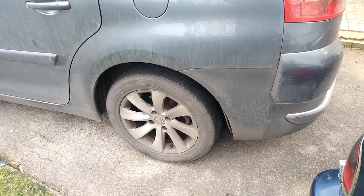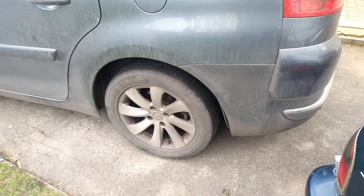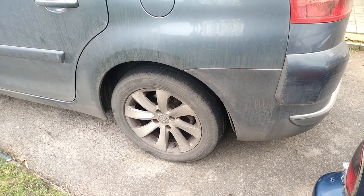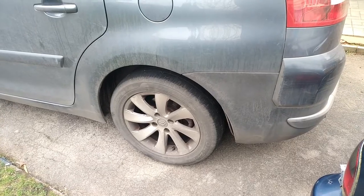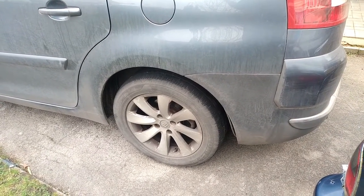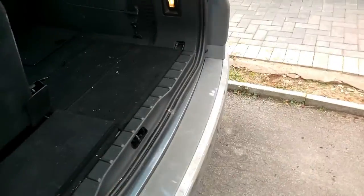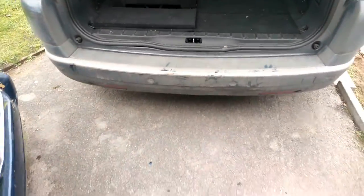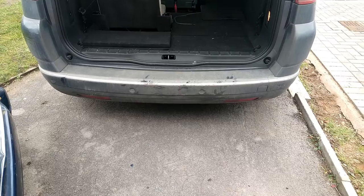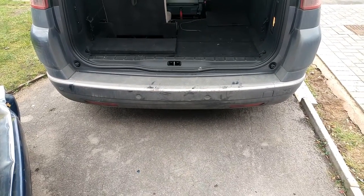So if you're having air suspension faults, and you realise it's a bag that is leaking, which is one of the most common things, do it as soon as you can. Because the biggest problem people have with this is they have a leak in the air suspension, the compressor then starts running more and more, particularly if it's running while you're driving just to keep air in the bag. The compressor will burn out, and that's a much more expensive fix.